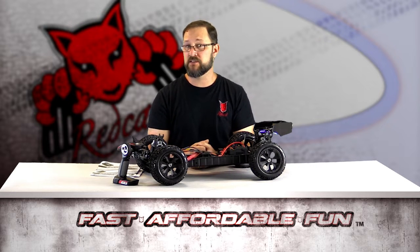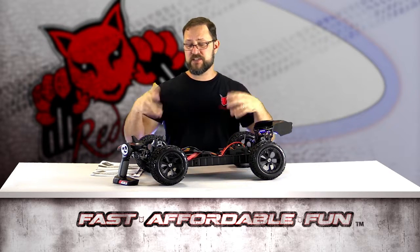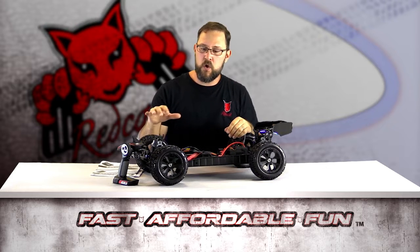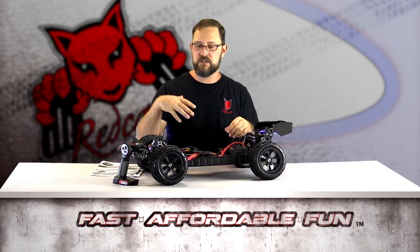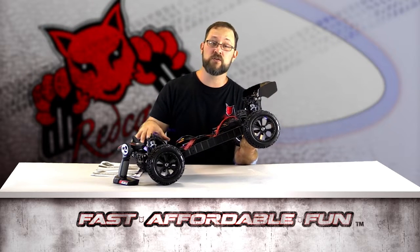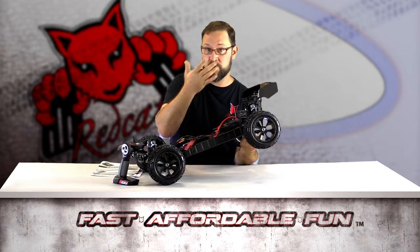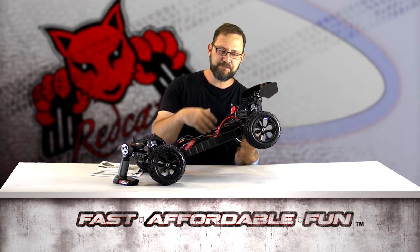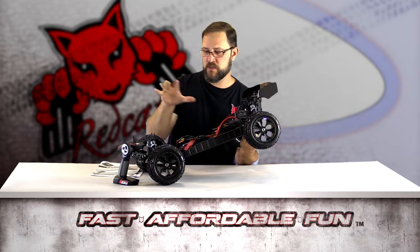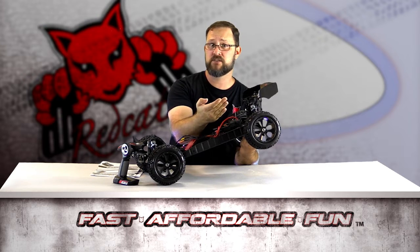And that's probably the biggest thing, is landing jumps on drivetrain shock. Because you figure, you're in the air, and even if you're not on the throttle, these tires are still rotating very quickly. And when you hit the ground, they stop immediately, right? So what happens when you do not have a center diff, for instance, and your tires are rotating and you land like this? Now, these front wheels are going to stop from contacting the ground, or drastically slow down, I should say, from contacting the ground. Well, if you have a locked center diff, which is your typical slipper clutch in the center, spur gear, what happens is these rear wheels are still carrying a lot of momentum, and these are big tires. So what happens is when these stop, it forces through the drivetrain these rear wheels to stop too, and they haven't even contacted the ground yet.